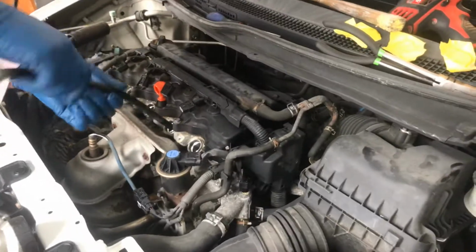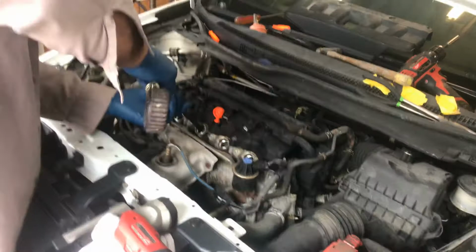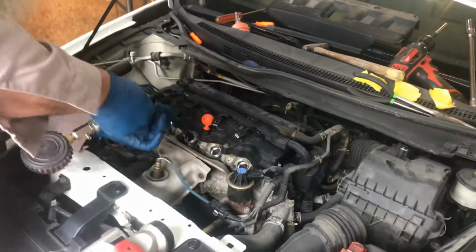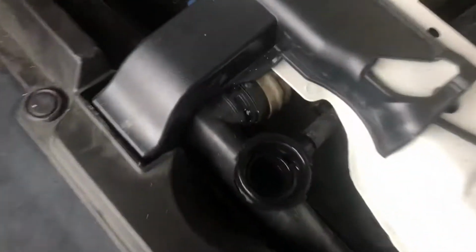Oh man. So what do you think it is, David? Head gasket. Probably running hot. Most likely one goes like this. Not old enough, don't have enough miles for the chain to be going. Right. So it must have ran hot and warped the head. Yeah, because guys, one thing we checked is we didn't have any radiator fluid, so obviously.